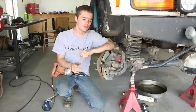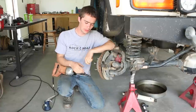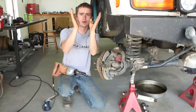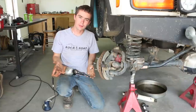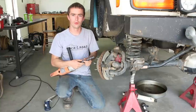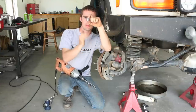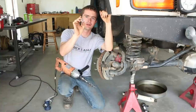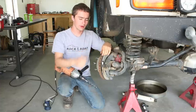The next thing you're going to want to do is ream your knuckles out. There are two different ways to do this. One way is to use a specific reamer with the GM taper to bore a tapered hole in your knuckle. Another option, which is what I'm doing today, is to use a seven-eighths non-tapered reamer — at the end it's seven-eighths all the way through, giving us a straight hole. Then Rough Stuff sells sleeves that don't have any taper on the OD, but the inside has that specific GM taper milled into it. We just drop that into our hole and our tie rod end will fit perfectly.